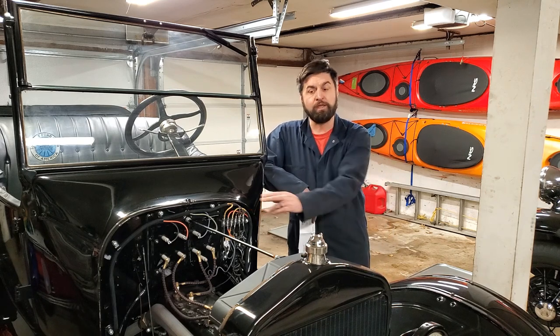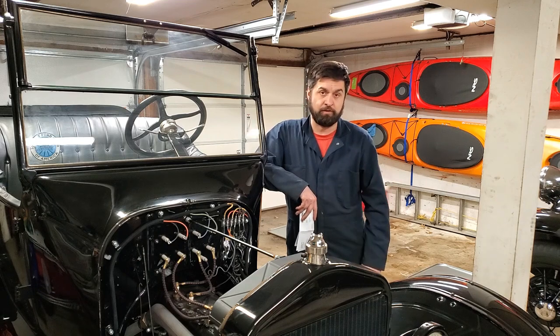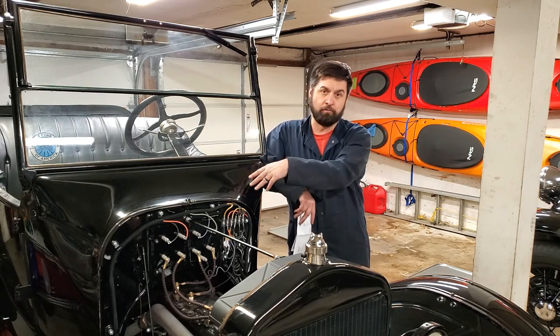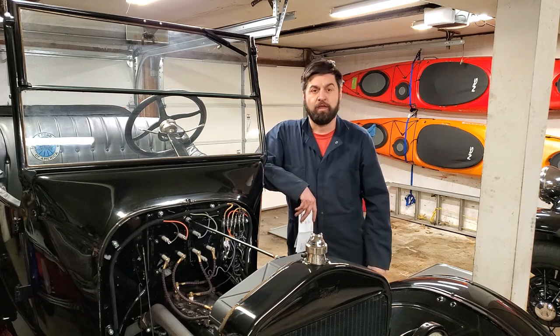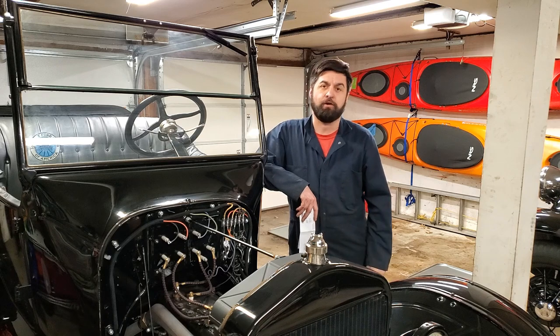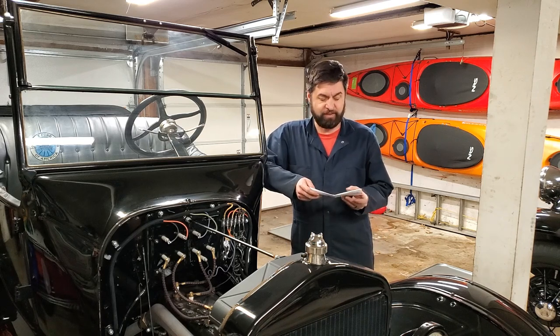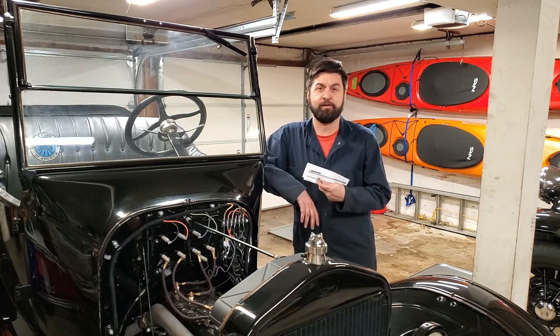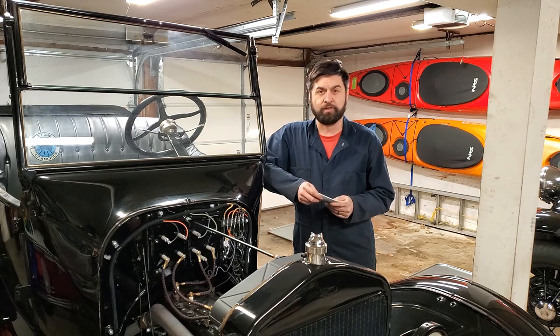But for a Model T, you want the engine to fire 15 degrees after top dead center when you're running the stock coils. So I bought a nifty little kit from Lang's. It was kind of pricey, so I have high hopes, but we'll see. It is the ignition timing indicator with LED. Let's take a look at it and see what it is.